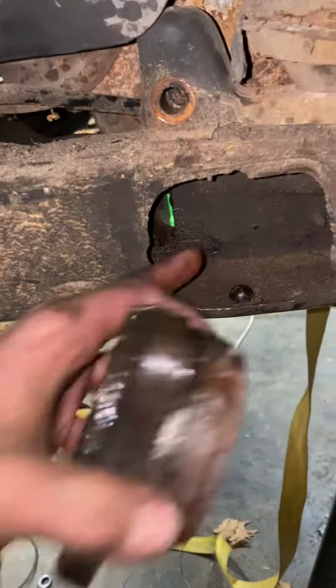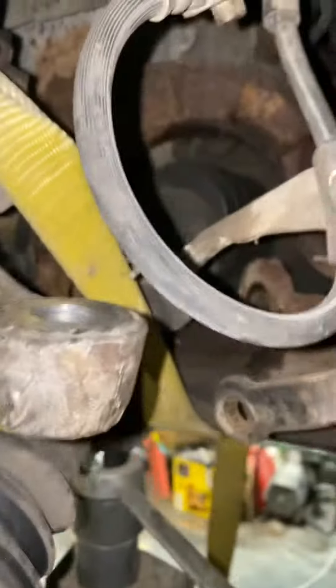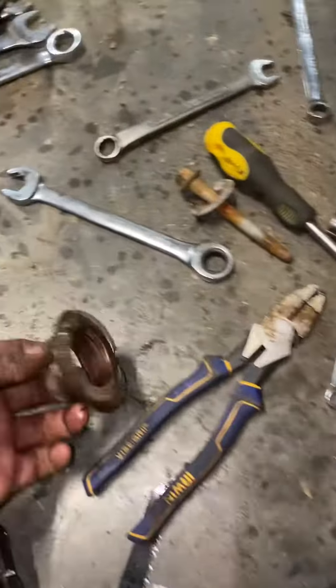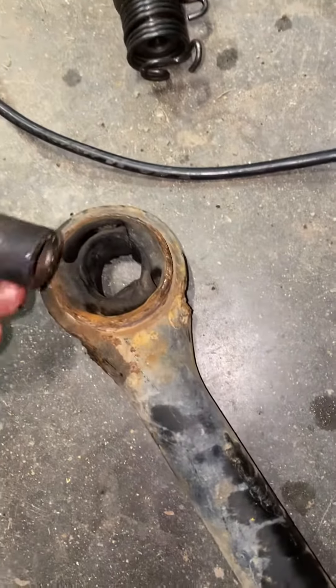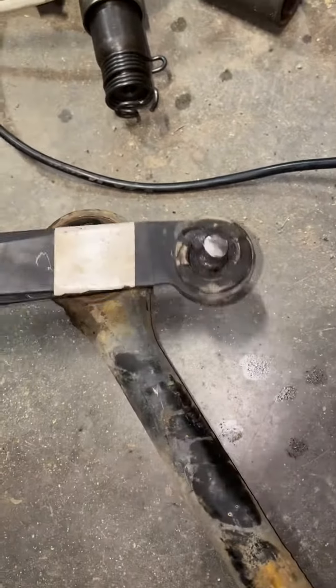Then we changed the a-arm - you basically have to drop and take this out. This one was seized up there too. Then drop that, and I'm gonna change this. Here's the axle. The sway bar was bad - this is crazy - the bearing flew apart. There are little balls around here. This is the control arm, and it was bad. The whole front wheel would turn and move. I had to use the grinder on the sway bar brackets. Here's the lower ball joint, pretty much messed up.